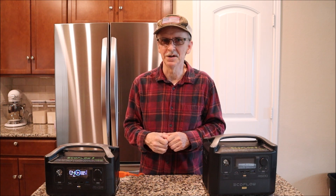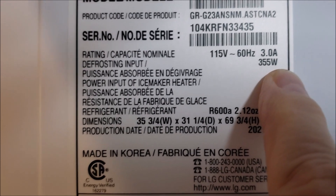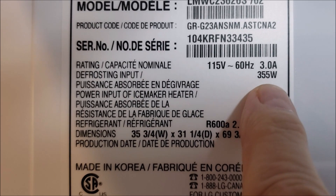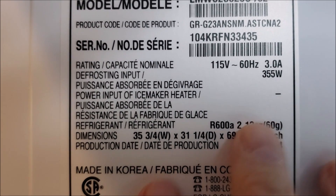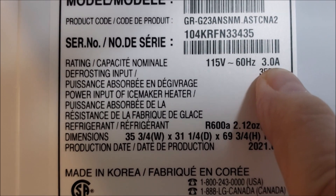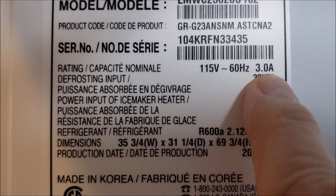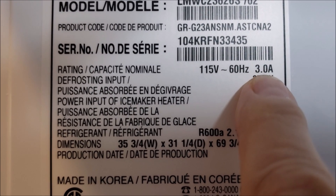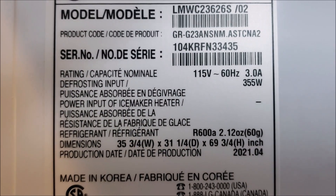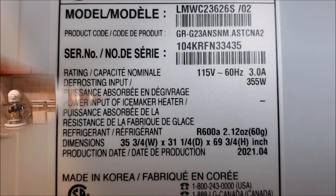Let's take a look at the label on this refrigerator. You can see the defrost watts are 355, and when I tested it, it was 383. So it's a good idea to add 50 to 100 watts on top of the label figure to make sure you're within the continuous running watts of your portable power station. Multiply the amps by volts — in our case that's 120 volts times 3 amps, which gives us 360, which is greater than 355. So I'm using 360, and then adding 50 to 100 on that to check if it's within the 600 watts on my portable power station — and it is.